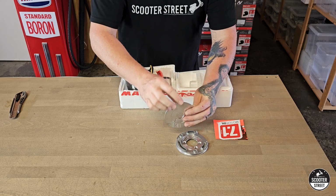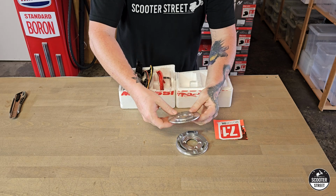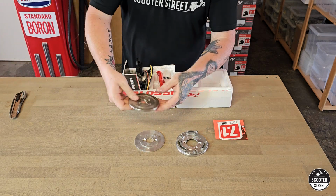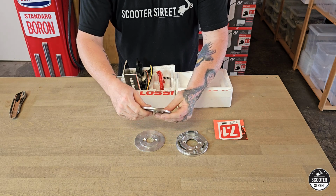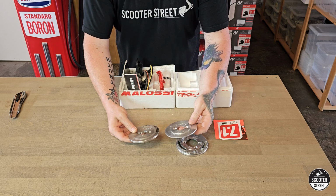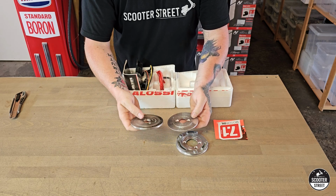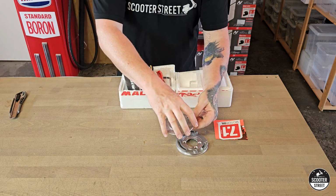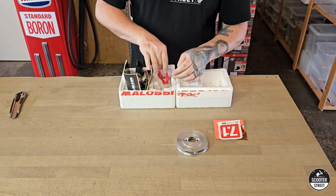Now, one thing that's interesting, and I did actually expect this, is this flywheel plate is way lighter than what you'd normally see on the liquid cooled one. Actually, I have, because it's an optional part to run, the flywheel plate from a liquid cooled version of this kit. And as you can see, it's much thicker. This appears to be aluminium, whereas this is steel. So this is quite actually heavy. Obviously having the fan on there adds a bit of weight and also a bit of resistance, so you don't need quite as much weight for your flywheel.